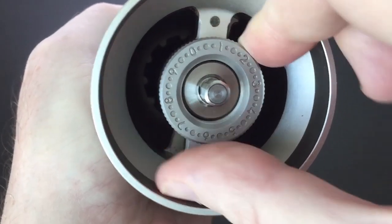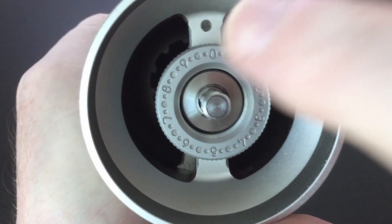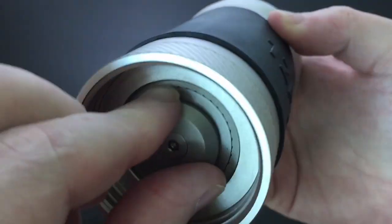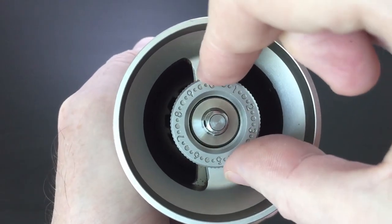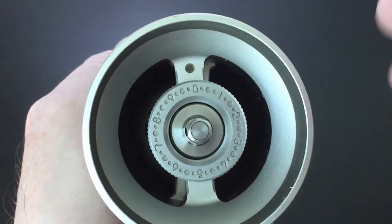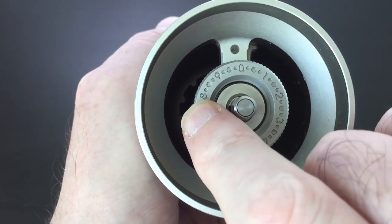Alright, see what we've got right now. And there, that's zeroed. You can see my burrs are fully closed because I can't turn them. So that is calibrated. I could turn that a little bit more slightly because there's not so much resistance, but I don't advise you to do that because you don't want to over tighten your burrs. But that's basically it. My zero was roundabout here.